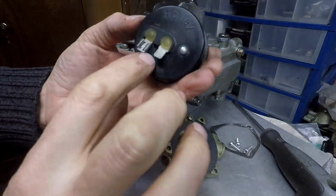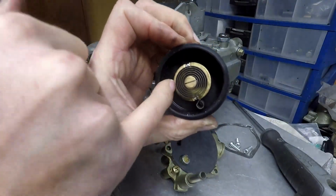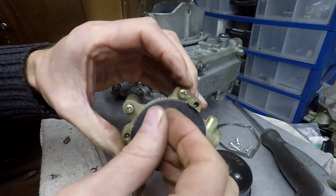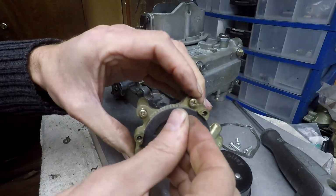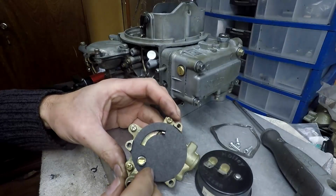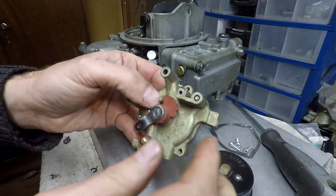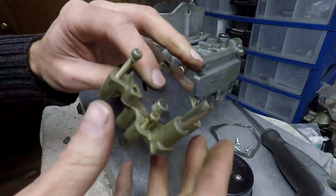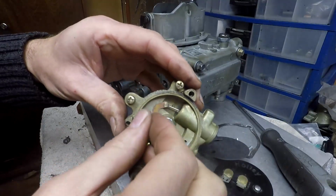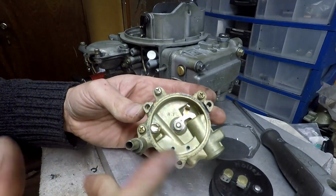And basically what happens is when you put 12 volts through here, positive, negative, it heats up this pad here, and therefore this coil starts closing up like this, which is what ends up opening the carb in this way. So it goes like that. That's the simplicity of this unit. And the reason there is a vacuum signal in here is because the vacuum signal actuates this piston there. So this is a combined choke pull-off and actuator all in one.